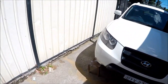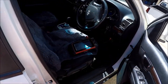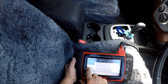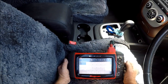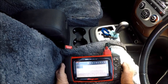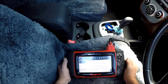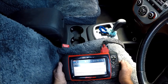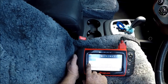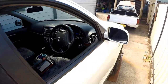We've got a couple of things on the run today. The Santa Fe we've been playing with — I'm just waiting for the temperature to get up to 70, and then we're going to do a DPF regeneration, or attempt to. There's been nothing but problems with this DPF if you've been paying attention. As soon as that gets to 70 we'll activate the DPF regeneration gadget.